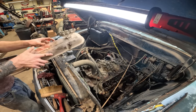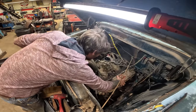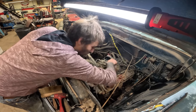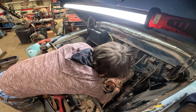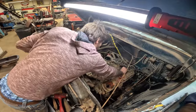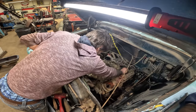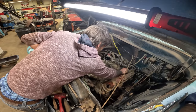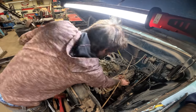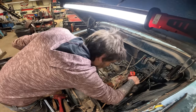Fuel pump. Okay. The ignition system. I kind of like to do them both together if we need it. I wonder what the points look like. Well, the first thing we'll do is test it for spark. If it has spark, then we don't have to mess with them. Some of them do, it just depends where it sat and moisture got to it. A lot of times when I pull them apart, it's all green under the cap and whatnot. You know how it is. Just take them lightly.